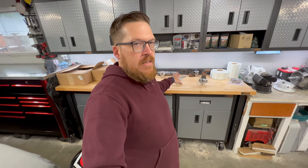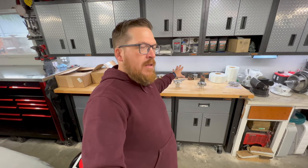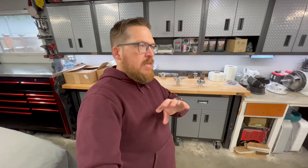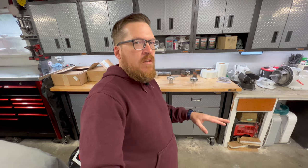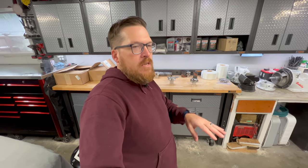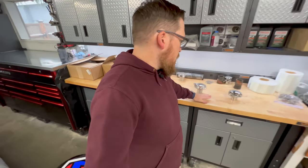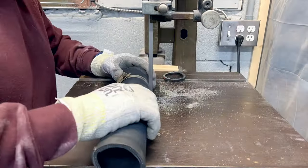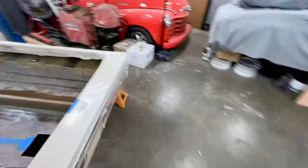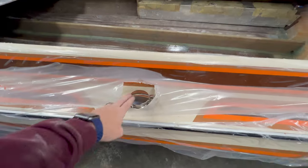As tempting as it is, don't grab your old fillers — don't use the old hose, don't install them into the boat for mock-up. I'm going to have to trim the new filler to get the fit and cut my new hose, but now is the time to take this step. You don't want to do this when the boat's all assembled, everything's polished and painted, and your interior is in — because if you need to make changes on the fit, you might be undoing work you've already done.